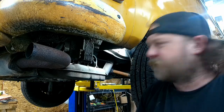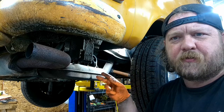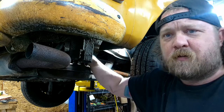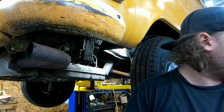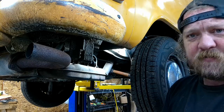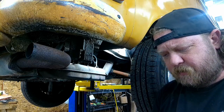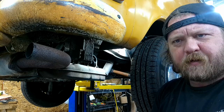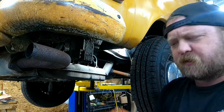All right, nothing you guys can really see, but you might be able to pick it up. Roll the engine over, doing cylinder 2 right now, and exhaust on cylinder 2 sounds like a door knocker. I didn't throw my bigger feeler gauges in it. What's the biggest one I have on this one? But she sounds pretty big. Sounds like it's probably an 18 or a 16. So let's start with an 18.